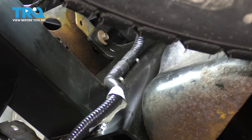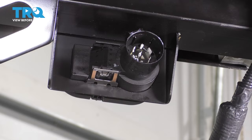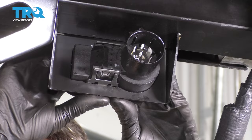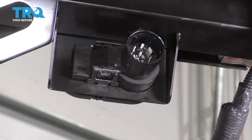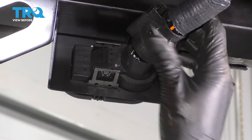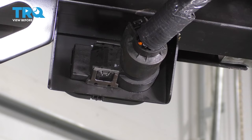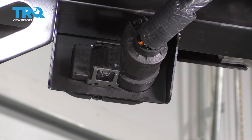Let's put the new plug in. It won't fit in any other way than the right way. Make sure it's clicked in and properly secured — it has two clips, one at the top and one at the bottom. If you don't hear that click on both top and bottom, you can take a little prying tool to seat the locking clip so it can actually lock on. Then don't forget to connect the connector. You can add a little bit of silicone paste if you want, but not too much and not directly to the connector pins — that'll insulate it. You want just a watertight seal with no restriction on the connection. Make sure this connector clicks. And there you have it — trailer harness and plug replaced. Now you'd hook up your trailer and test it out.